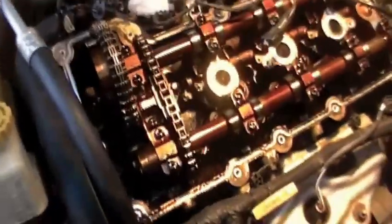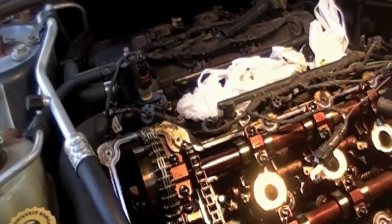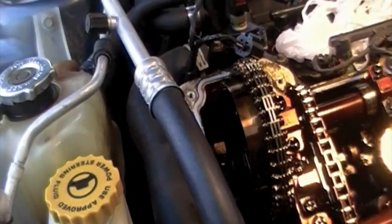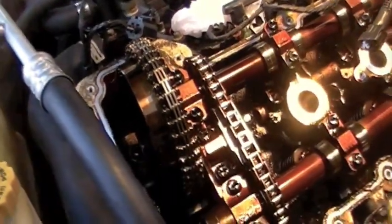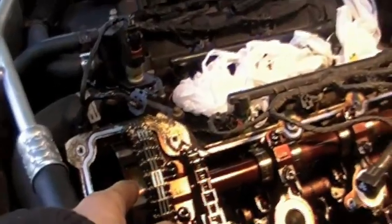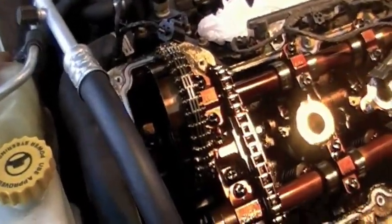Clearly, as I showed over there in that little pocket, you can still see it there. So basically, I have to be pulling this other valve cover off, and then start pulling off under there - taking that harmonic balancer off as well as the power steering, and then I can unbolt the camshaft sprocket and loosen off the timing chain and get it all good to go.